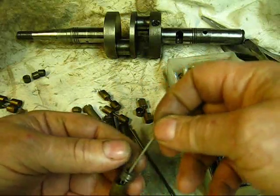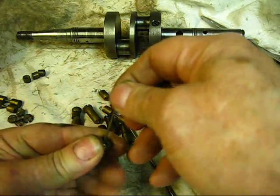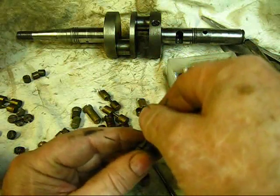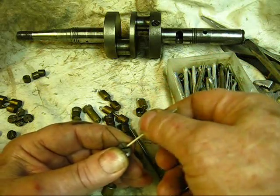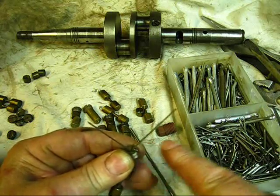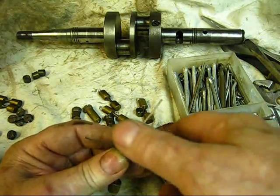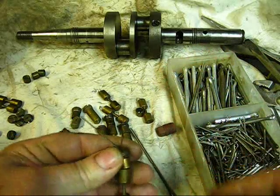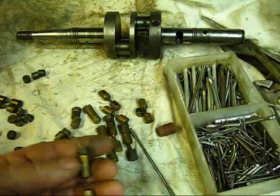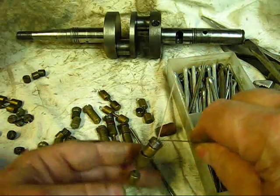Set that right, then put your collar on and put your unplated cotter in there in the correct size — it'll be way too long, but you want that so you can hold down on this and spread the ends apart. Spread one of them completely over and snip it off — do not snip it too long or it'll stick outside your thread. Do one side and then the other, and you have an assembled governor without needing two pairs of pliers trying to pull it apart.